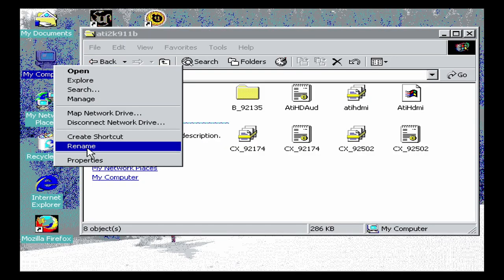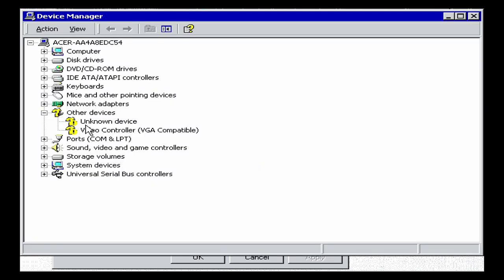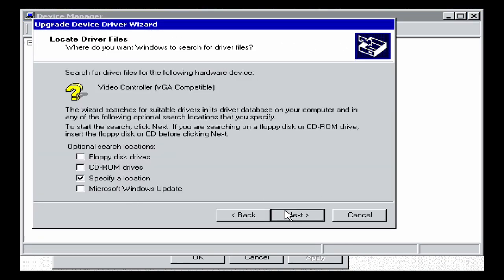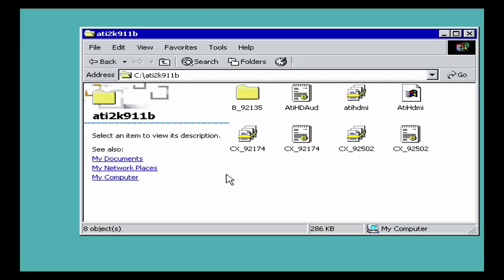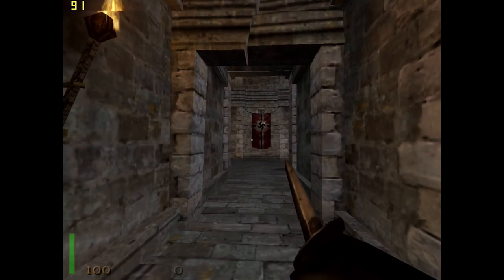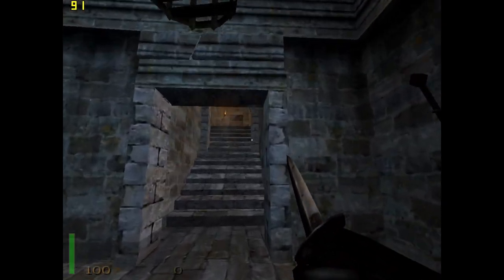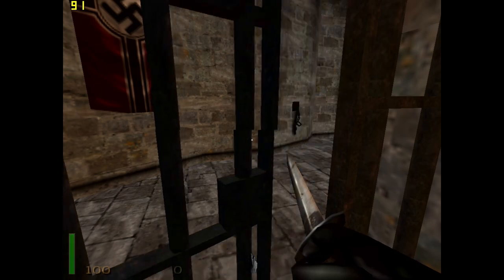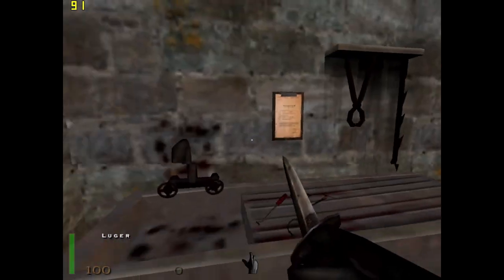I needed to decide what GPU to install, and I decided to go with the Radeon HD 2600 Pro. It's definitely not the most powerful GPU, but I think it's a good match for the era of games this system would end up playing. A bonus is that it requires no 6-pin power cable, which this power supply doesn't have. Unfortunately there were no official drivers available for Windows 2000 for the 2600 Pro, but luckily that's something Blackwingcat has been working on, and the first driver I tried from him worked like a charm. There are plenty of videos showing the process of patching and updating Windows 2000, and I'll link one of those below.